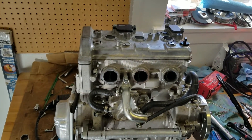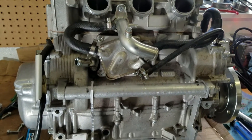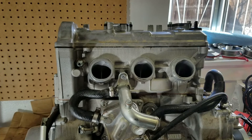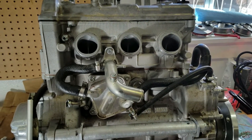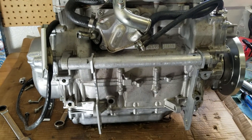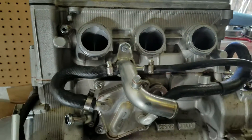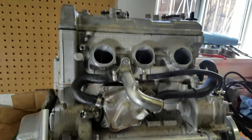Here's this baby buttoned up. I'm going to get some new spark plugs because those were pretty hammered — just burning oil and crap from what happened. I'm going to get new spark plugs, a new oil filter, and do probably a quick oil change right after I get it started, just to flush everything out. The oil is cheap. Get these little hoses, go through the whole thing, look for little details, get everything tightened up. And then try to set it in the chassis.